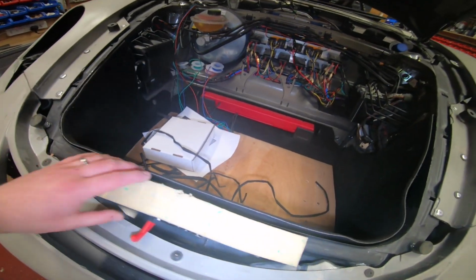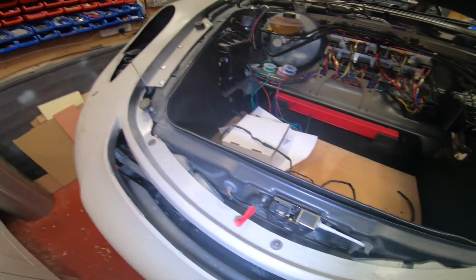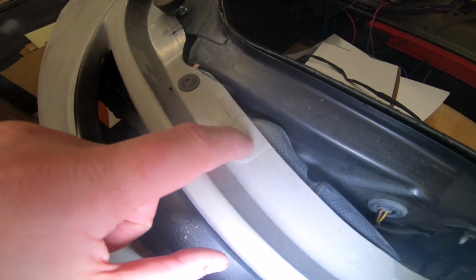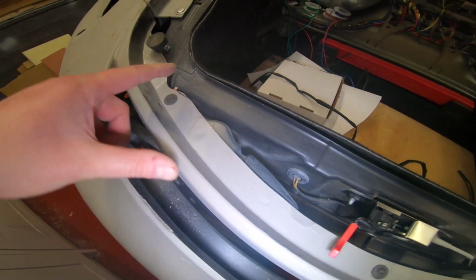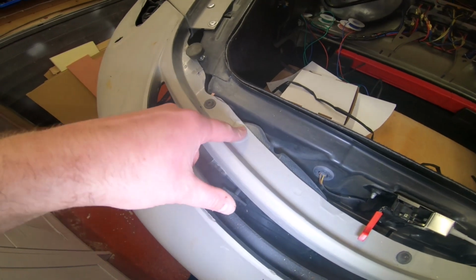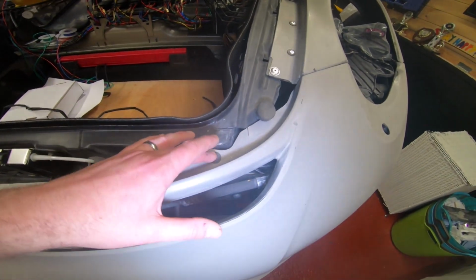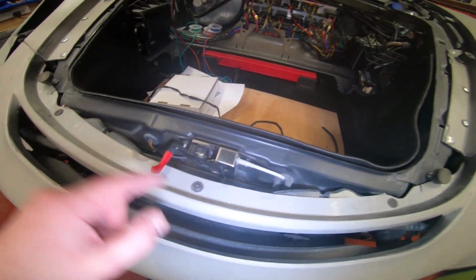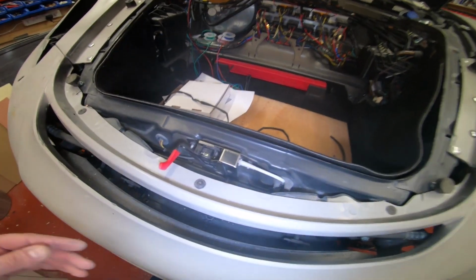When you get your kit, you can see how it's molded off a real bumper. That indentation there is where the real bumper originally fits to the RS, and obviously you're not going to use that. So you just need to be careful before you drill any holes. Be sure where you're drilling. That center one is the most important one, because that's the base for everything.